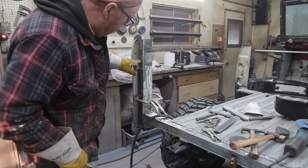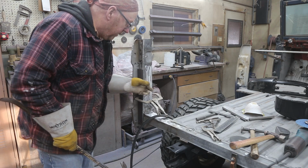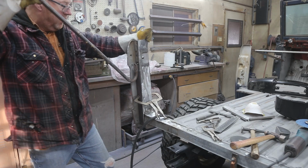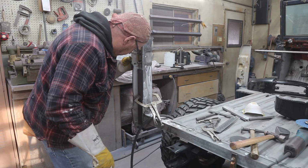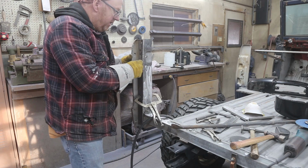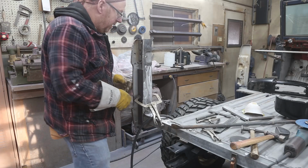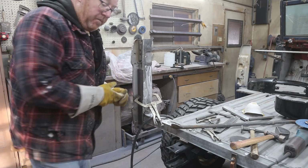Okay, now I've welded on the bolt, and I made sure I got a plate here so I don't dent this again. It's about the only way that you can do this on this box stuff. That looks pretty good, because they build this stuff out of fairly thick material, so stud pullers just aren't going to work. So I just weld the bolt on and do exactly that. Yep, I'm going to put a zip cut on, move that down a little bit.